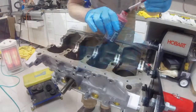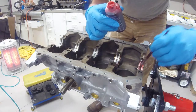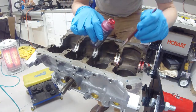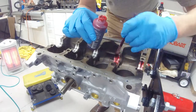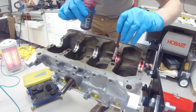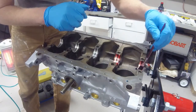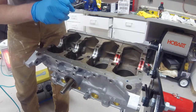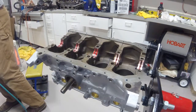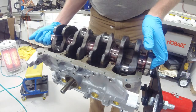The step before installation of the crankshaft is applying assembly lube to your bearings. The assembly lube is the lubricant for your motor before it sees oil on startup — this will allow the bearings to all be lubricated before the initial oil flow into the engine. Apply a generous amount to the top side of all of the bearings before installing the crankshaft. We will be doing the same to the other bearings before applying the caps. After lube has been applied to all the bearing surfaces, I have also applied it to the crankshaft itself.